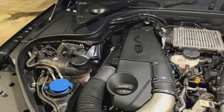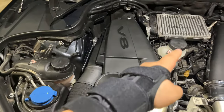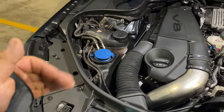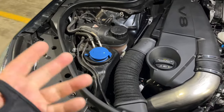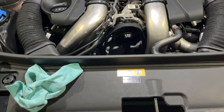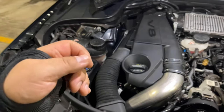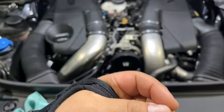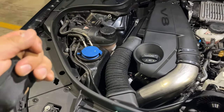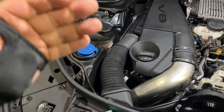They cool down your turbos, and this high temperature system is cooling down your engine. In this case, this one looks much cleaner than the other. So if you want to do a little flush to clean up the bad coolant — for an entire flush you need to vacuum — but for a simple flush, you can take the plug off on the bottom of the radiator, drain it, then fill it up. Run your engine for a little bit to let it all circulate, then do the same thing again — flush the coolant out of the radiator plug and fill it up again. After you run it you'll see if it's cleaned; if not, keep doing that procedure until it's all clean.